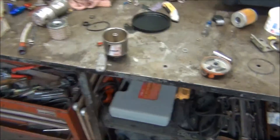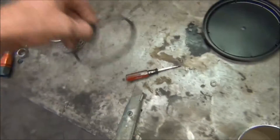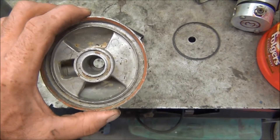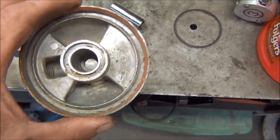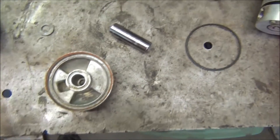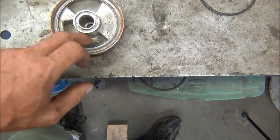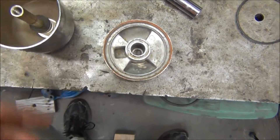Okay, we got everything torn off of it. The first thing I'm going to do is clean up my Fram filter canister. Before I clean it up and show you how it goes together, here's the new filter and seals. There should have been two seals but I only got one, so I'm going to use the existing one. If you watched my previous videos, I talked about using E85 in the Torino and a lot of people talk about corrosion — I just want to show you what this filter canister looked like inside. It was on this car like 10 years, way too long between filter changes for sure. But it's not really that bad — I see a little bit of residue, but I've seen small engines with regular pump fuel, which does have ethanol, cause that. It's not causing a lot of bad stuff here. Just wanted to show that.